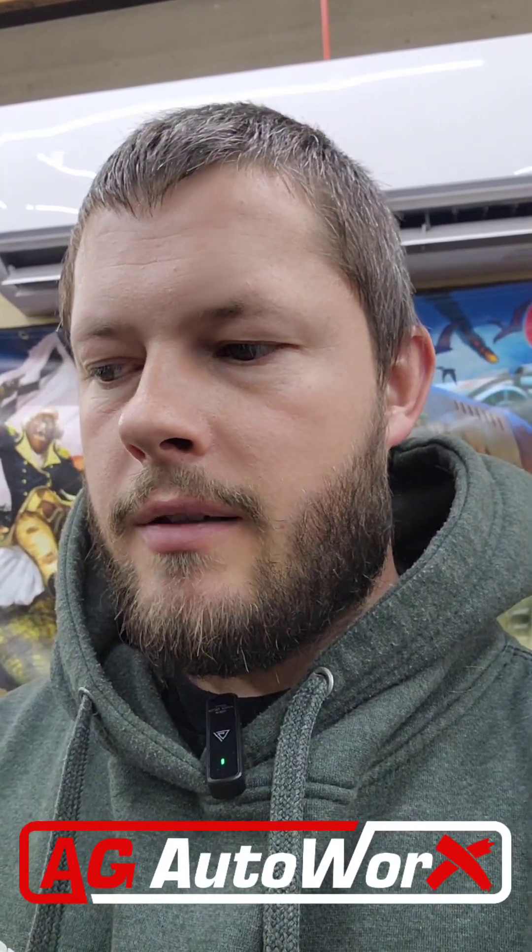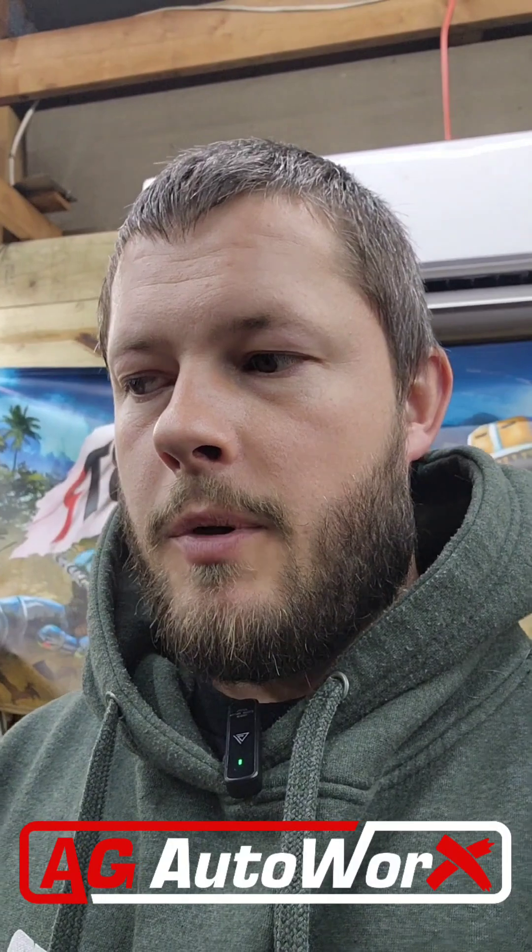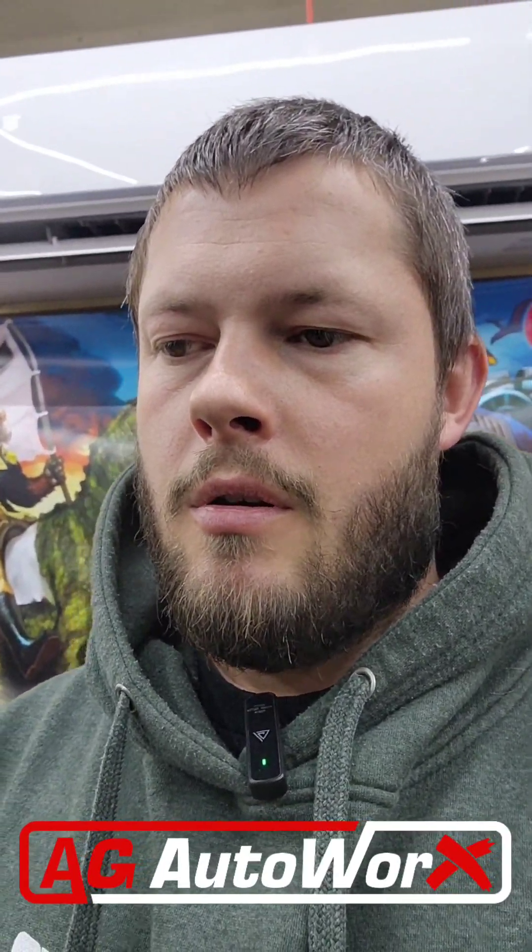In the theory of operations, it shows that if the crank sensor does not work, it will still fire off of the cam — well, this one's not. I continued to mess with the crank sensor because I knew there was a problem there. After repinning everything, I have no idea what else I can do to fix the crank sensor issue. To me, the PCM is good because it's getting a ground and it's supplying the 5 volts it's supposed to. It doesn't make any sense why we're not getting the signal. I've even tried adjusting the crank sensor closer to the reluctor wheel — no difference.